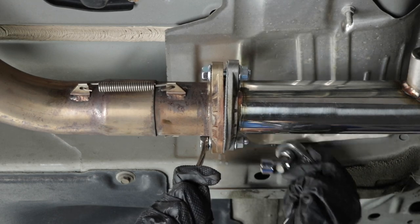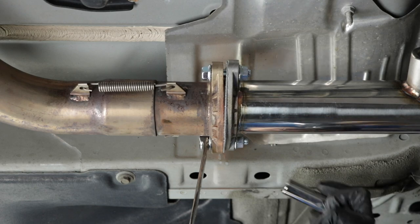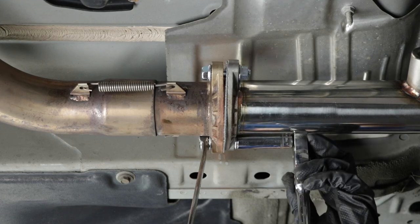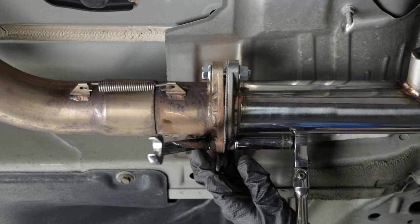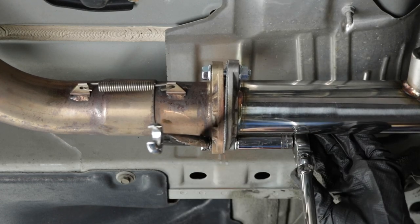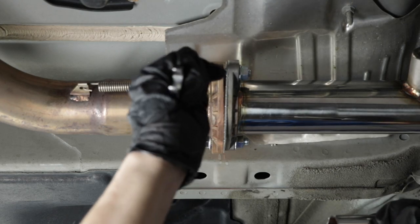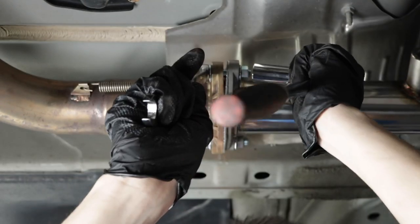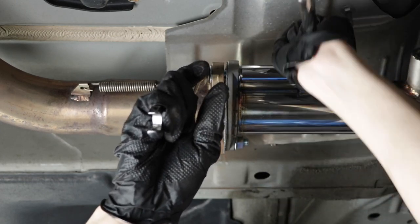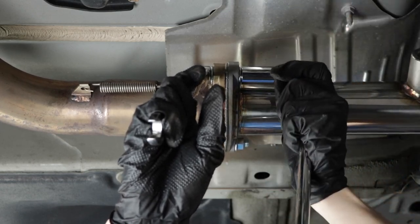I'm gonna get rid of this extension swivel socket thing, because it's kind of annoying when I'm trying to keep the ratchet from spinning, bending. All right, so I'm gonna use the exhaust as a leverage point for the wrench. I'm gonna snug up one side. I'm not gonna go super tight with it because I wanna seat both sides at the same time, but I wanna make sure that the gasket squeezes flat